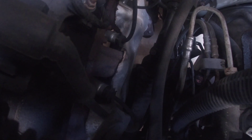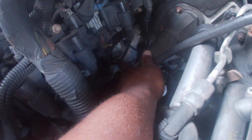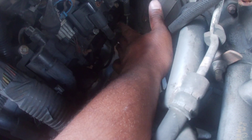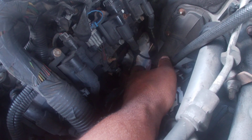Now on these trucks, in order to pull off this coil down here, you may be tempted to pull on it right here at the bottom. If you pull on this coil at the bottom, you're going to damage it — you're going to pull the coil out from the boot, but the problem is that you won't notice it.